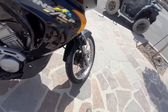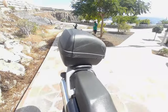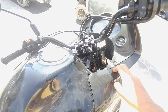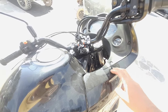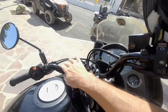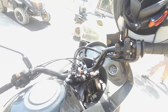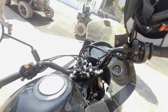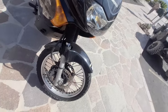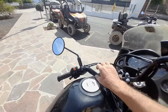There is a weave on this bike at speed, especially if you fit the top box. It's not going to shake you off, but I wouldn't take both hands off the handlebars at speed. I'm going to try to eliminate this by fitting lower bars — a motocross-style bar — and adding bar-end weights. I could re-true the front wheel but I don't need a new tyre yet.